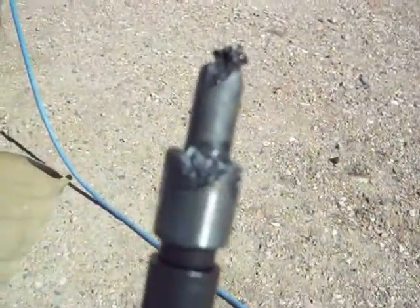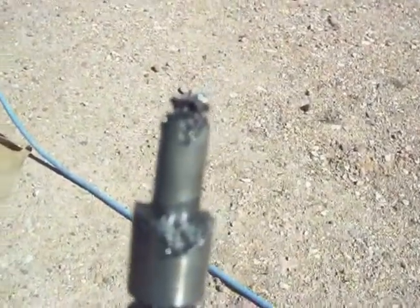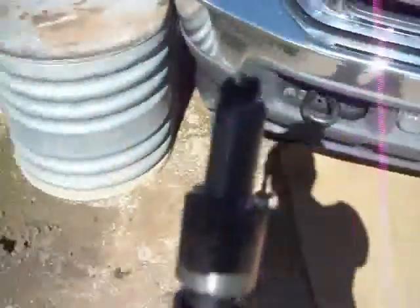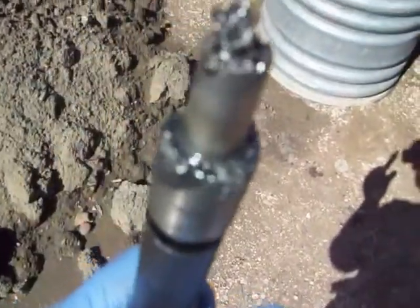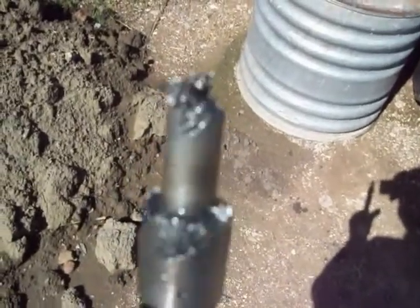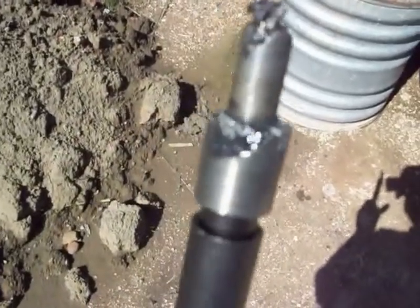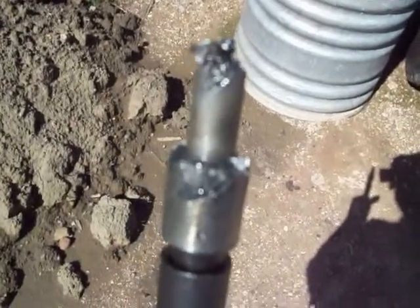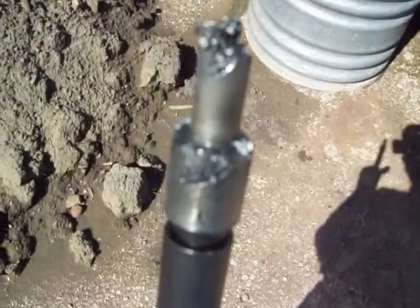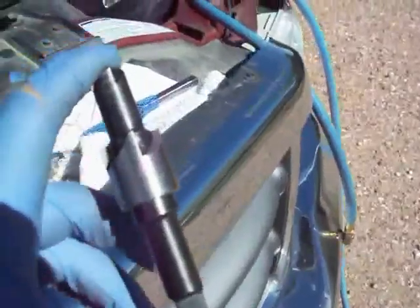Here's the seat cutter just pulled out of cylinder one. There's not a huge number of chips but there are definitely some, and the grease did catch a good portion of them. The tip reams out the old threads and the fat piece on the end cuts the new seat. I ran it in until it just spins freely — you can tell the cutting force stops and the tool begins to ride on the old seat. When it just starts to spin freely, you know you're done, and you pull it out.